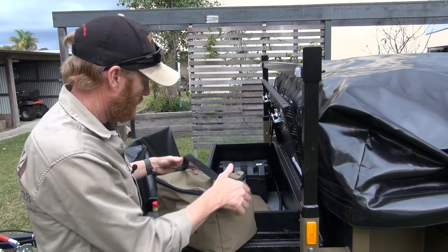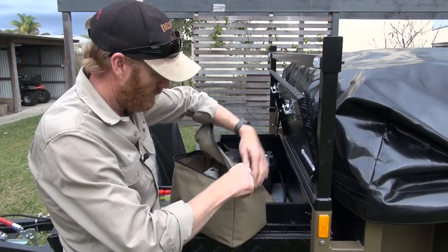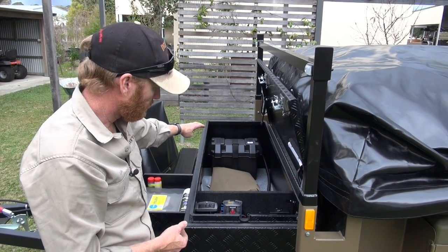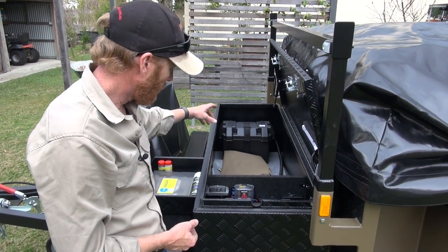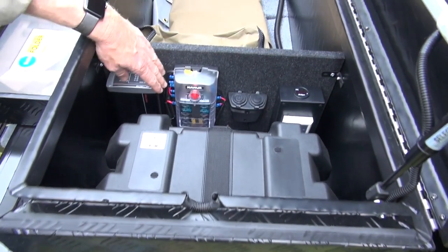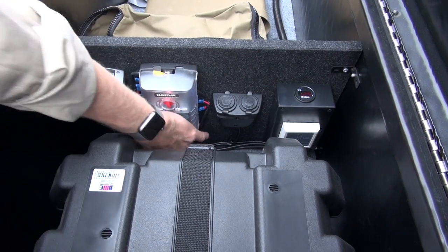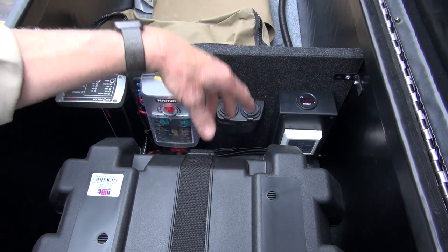Here's one of our canvas bags with all your pegs and ropes — that's in there. On this model I've got the dual battery setup. Standard comes with one battery; on this one I've got the second battery. You can see there's a kill switch with a fuse block and a projector charger. We're using this here now so you can see the voltage at all times — if you turn the kill switch off it'll turn off, but you can always see where the battery is.